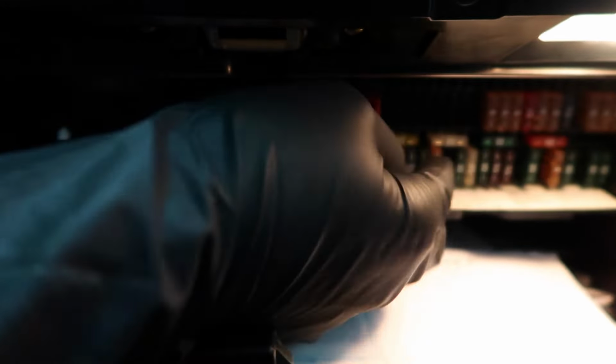Alright guys, so the first issue that I'm going to show you is the sunroof motor. If you hear some very faint clicking, or if you don't hear anything going on at all, first you're going to want to check your fuse. The fuse for the sunroof is number 46, and you'll find the fuse in the glove box. So right here, you open the glove box. Once you open the glove box, you'll see two white tabs. You have one white tab right here, which you have to make straight. You have another one on the other side, do the same thing, and then the whole fuse tray will fall out. And then you can use your little guide that's right here and figure out which one is number 46 and then go ahead and pull it off. This right here is your fuse puller, so you can use that to pull the fuse off. When you're done, go ahead and close it.